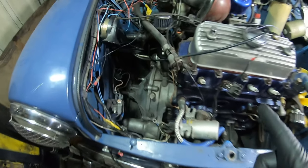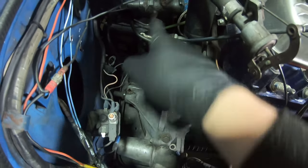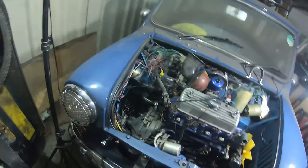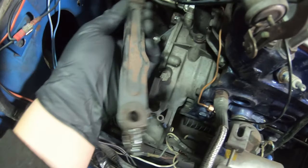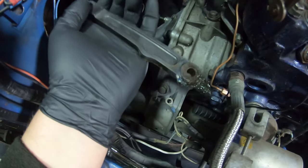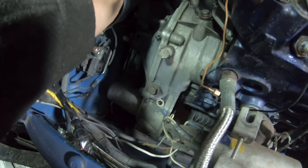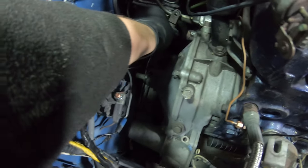So, before I get into it, there has been a few things I've removed just to get access to the brakes and etc. I removed this. This is an uprated mini sport clutch arm. And that just goes down into here. And then it works onto the slave cylinder and it pivots, and as it pivots it pulls the clutch in